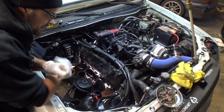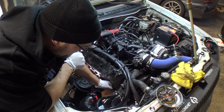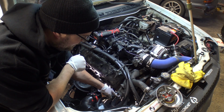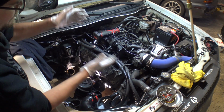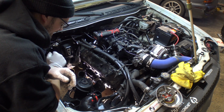A nice thing about pulling these heater hoses off is I'll pull the longer one and then push it down into my drain pan, and then what I'll do is I'll pull this one off and I'll blow into it, and it'll push, you know, a decent amount of excess that would get sloshed out anyway right out. Makes it less of a pain in the ass.